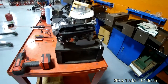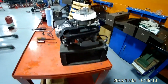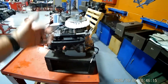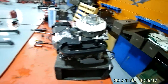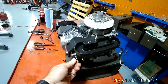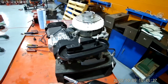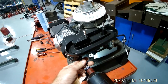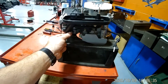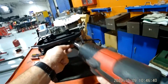This is video number two on these Honda engines, how to take them apart. From the last video, this is where the air filter is and it filters the air coming into the engine. To take this air filter assembly off, you have a 10 millimeter socket — that's the size of the socket you need, not the nut itself, which is probably a 6 millimeter nut. The 10 millimeter socket takes off both of these nuts.